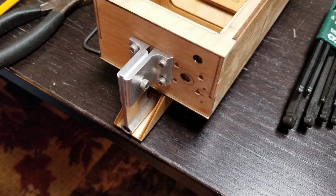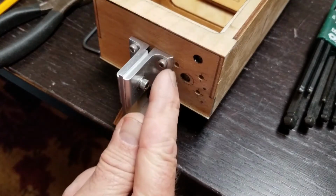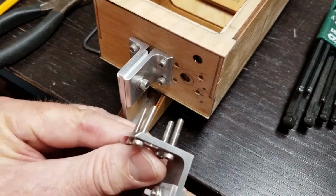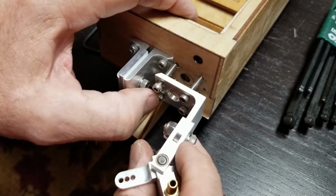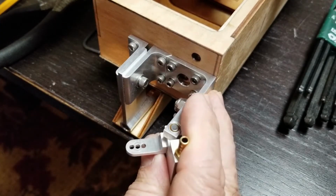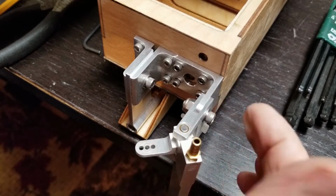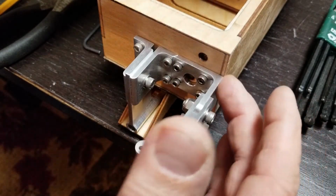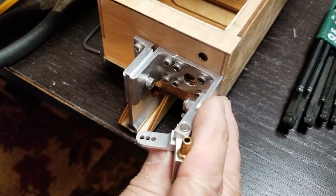Here's a tip I saw someone do somewhere one time on a thread. When you have a transom that's kind of tight to mount everything, I followed a 45-degree angle on this right strut bracket and a corresponding 45-degree angle on the rudder bracket. Now they snuggle up nice, looks nice, nice fit on those two 45-degree angles there. Lets this move in that way, probably close to 1/8 of an inch, and then keeps this from sticking out past the side of the tub. It's slightly below flush right now, which is just perfect.